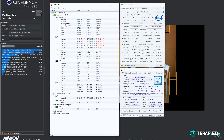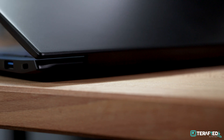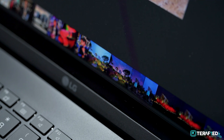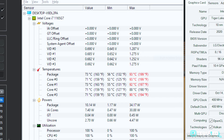But of course, it's not without its flaws. On performance mode, whether rendering or gaming, the chip will basically stay around 90 degrees Celsius all the time, which isn't really ideal. But it's not unexpected because you can barely hear the fan at all. Despite LG Control Center stating that there might be an increase in fan noise, there really isn't any. The fan profile on the Gram 17 is really conservative, and thus the high temperatures. Switching to optimal does bring the temperatures down to the mid-70s during load, but as mentioned, it does limit the power of the CPU.